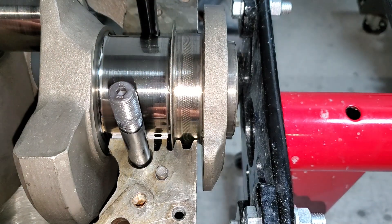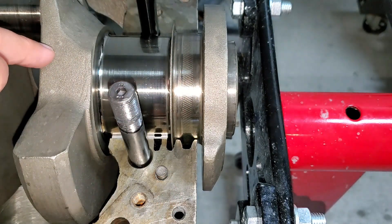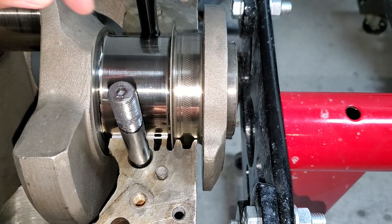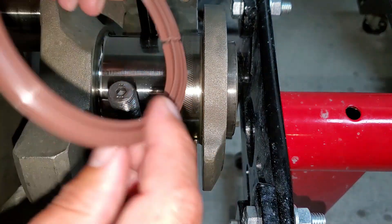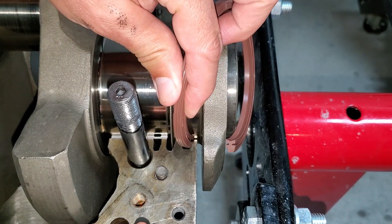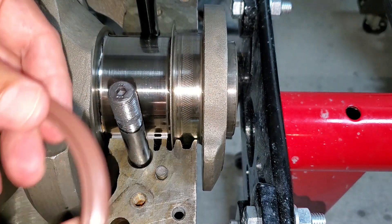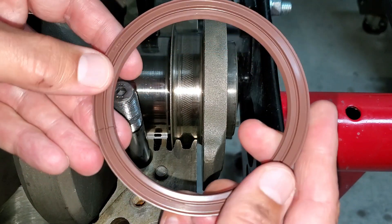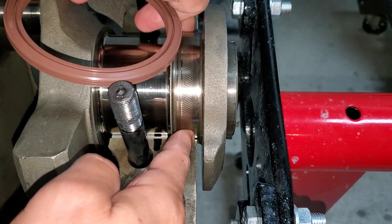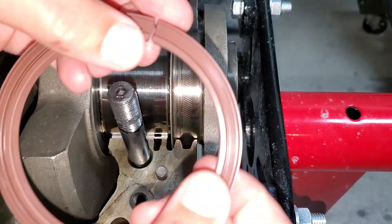Some of you are going to ask: can I install the one-piece seal while the crank is in the engine and the engine is in the car? The answer is yes, but it's not recommended. You can push the rope seal out and carefully thread this in like a slinky, working it around until it comes out the other side. If that's too daunting, you can get a two-piece version — it's cut on both sides like a half moon — and rotate it into the slot, then RTV the ends. But again, that's not recommended; you can damage the seal.